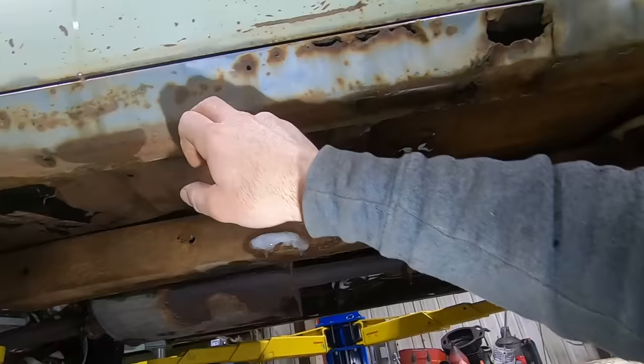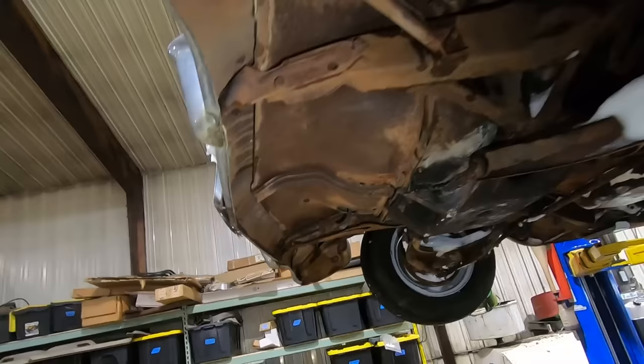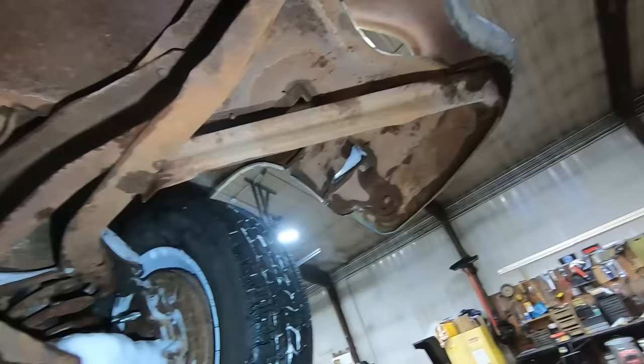Dog leg's good on the fender on this side. This piece of trim kind of holds everything that comes off the tire up there and rots that and the fender extension off. The frame's been tweaked over a bit, so we probably want to straighten that out before we get too crazy with the bumper. This side looks good yet, though.